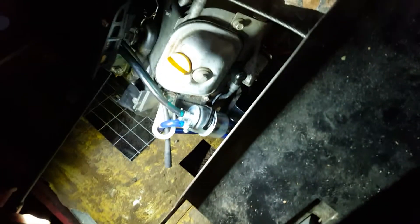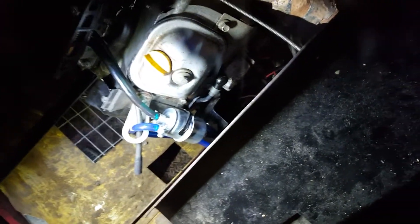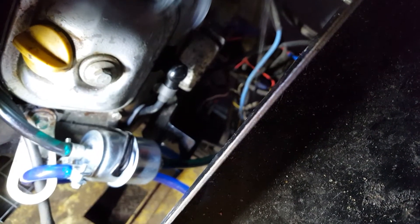This is the fuel pump with a return back to the tank. Come down there — I know, too many filters — but this is returning. This line goes to the carburetor, and this line goes back to the tank at the top, so it's not feeding off the bottom. It's running relatively well.